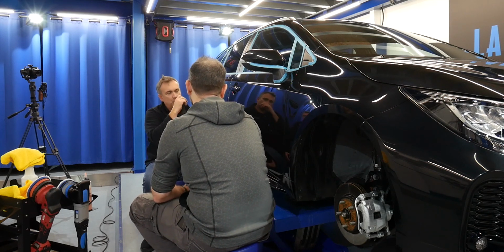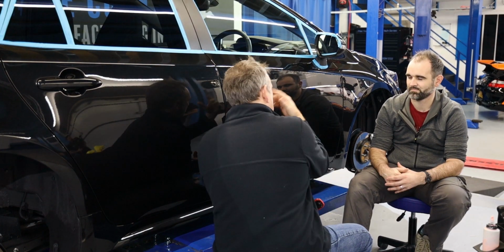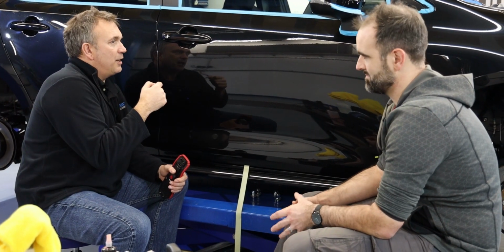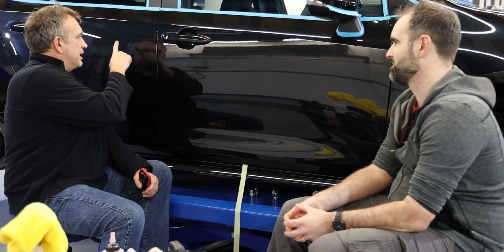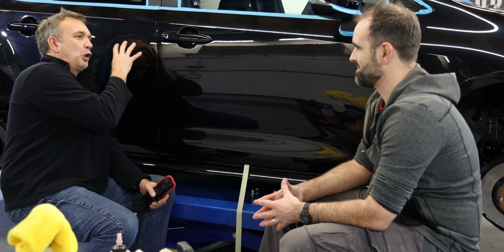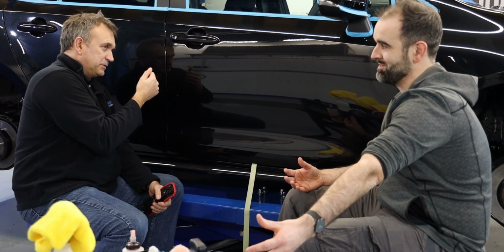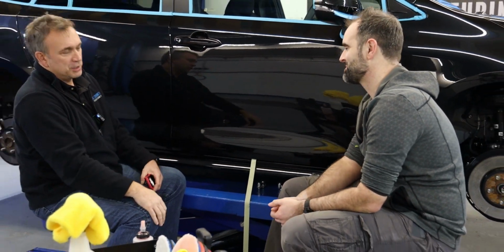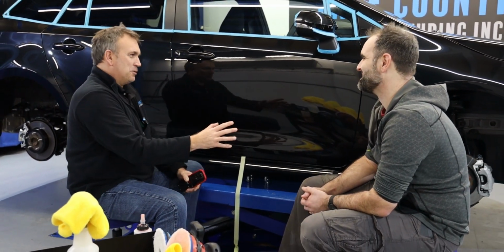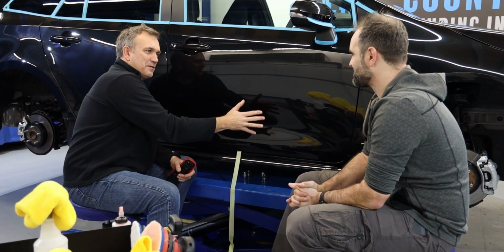So we had this discussion: would you keep switching pads, maybe sizes of machines and pads, and keep swapping pads and compounds, or would you just stick with one? And in this case, you had the speed down low with a small amount of compound. Yeah. When you get to an area like, I can see a little bit of dirt there, if there's a deeper defect, now I've shown you, stay in that area for longer, maybe a little bit more pressure and speed. Exactly, and because you're not ramping it up to four, you're at two, you've got that extra adjustability to go up. Yeah. But this could scare people if it's gone and done that hazy. Yes. I know, and you haven't seen yet, we're going to refine that down with a finishing foam pad and a finishing compound, and we'll be able to remove that and make it really shiny.